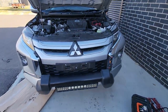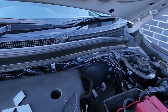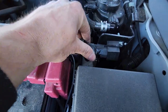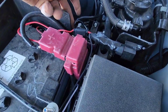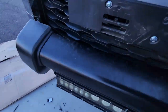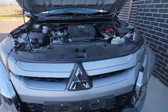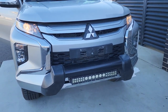Now it's time to do the harness — just tidy all this up, zip tie it. The final wiring comes up, follows around the back, cable tied on, with a little loom to get rid of some spare. The relay's in there — just a cable tie around it and through the cables. It'll give it the best chance on bumpy roads even though it's not vertically mounted. You've got all your cables, your fuse, and two cables going down — one's loomed up here which is the 12-volt, and the other goes all the way down to the light, connected there. Clean up, drop the lid, turn the headlights on, get high beam — high beam's on, it's working.